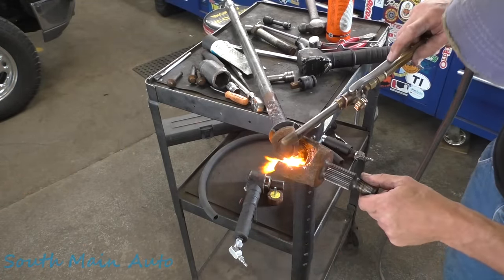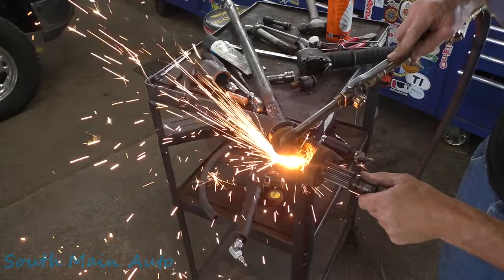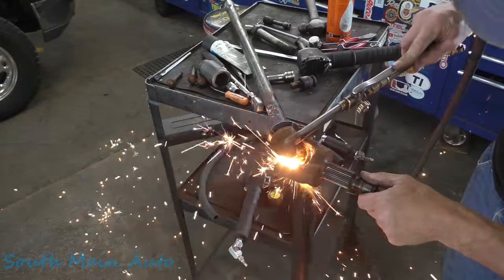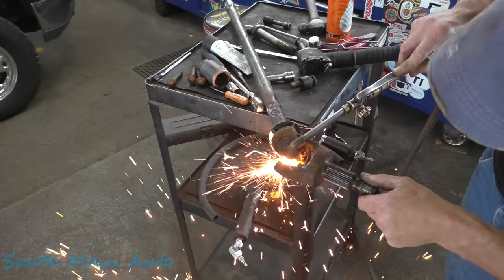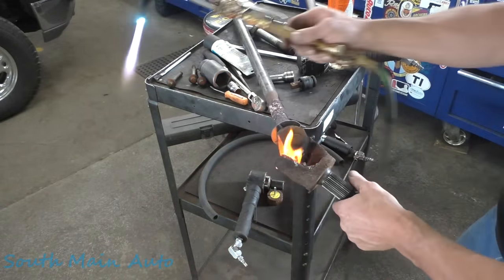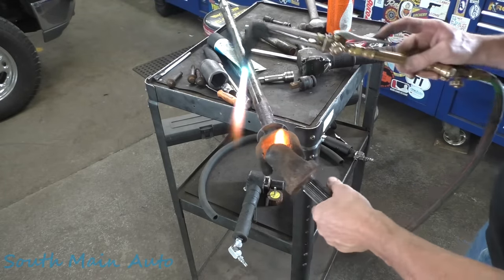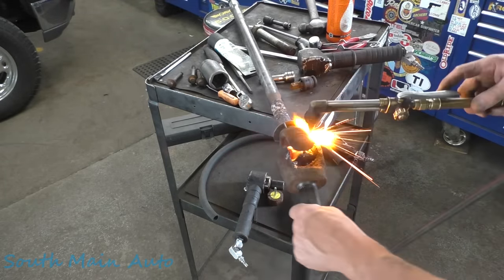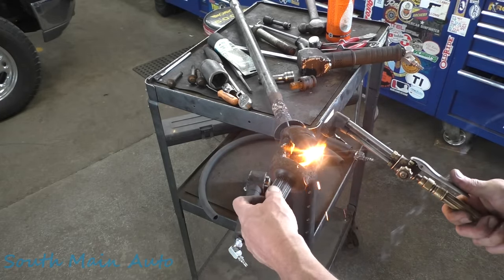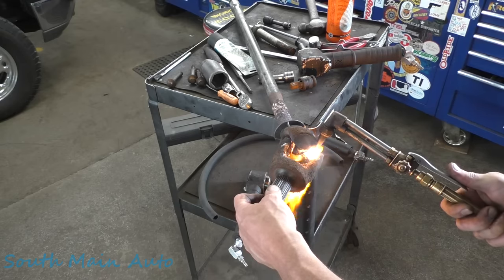Center of that cross. So I say, make sure you're cutting away from that. I've seen some of them blow out a big old gob of fire and grease. Whoa. Doing a burnout. And just because you cut through one side of the cross and heard it pop doesn't mean the other side ain't gonna get you. Don't be fooled.